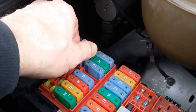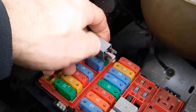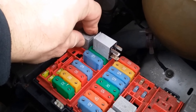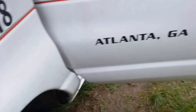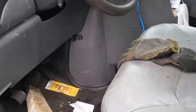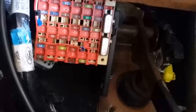Right here is your brake light fuse. What you can do here is cheat - these two relays are exactly the same. Pull them both out one at a time, set them so you know which way they go, and swap the relays out.